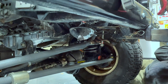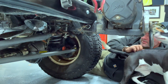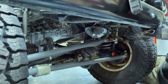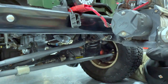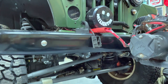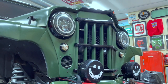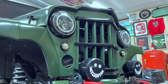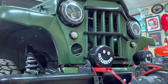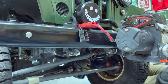The spring rate and the springs — we do have a lift in here, about four inches of lift as it sits right now. We basically had to play with the springs and the spring rate because of the weight of the body. With this 1958, it is all steel and there's a lot of glass, so this body weighs a lot more than a traditional 2005 truck. We had to figure out spring rates, and then we did some really cool shocks with it too.